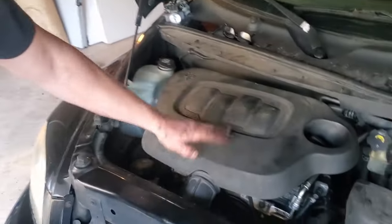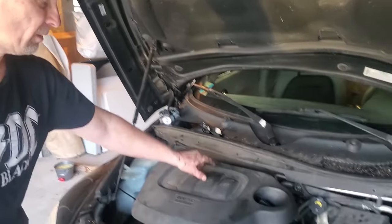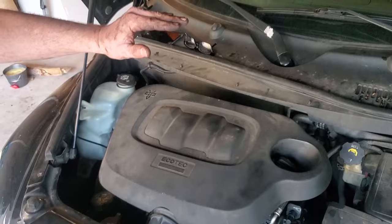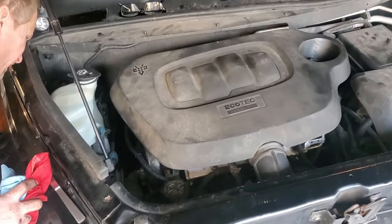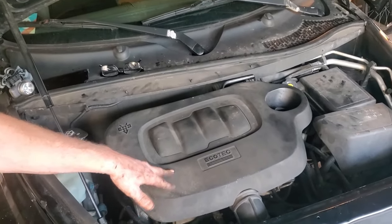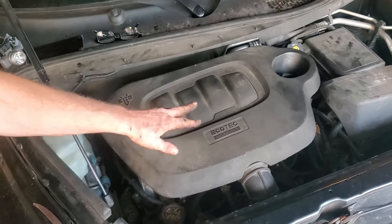All right guys, we put everything back together including the air intake temperature sensor — tighten everything up, checked the oil, it was good, three-quarters full. Started it up — engine sounds good, it actually sounds better. Because there were those two bolts that hold the cam caps in place on the back camshaft — they were literally loose enough that I could spin them with my finger. So as the engine was running before I would hear those bolts rattling. We got everything good. I don't see any oil leaks anywhere, there's no oil coming down the back, and it's not smoking on top of the manifold like it was before. So I think we're good. That's how you replace the valve cover gasket on an Ecotec 2.2 — the procedure is probably the same on most double overhead cam engines. It might be a little different on a Nissan or Toyota, but this should work with the 2.0, 2.2, and 2.4 Ecotec GM engines. Thanks for watching.